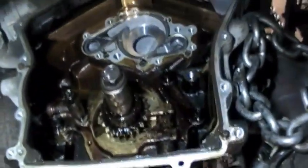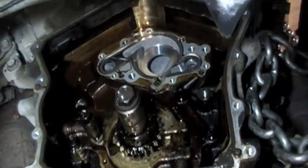The timing chain will actually rub up against the water pump - here's where the sprocket should be, and the timing chain runs down here and goes around. There's a little cover on this part of the water pump, and the timing chain runs past it and scrapes it. If you drive your car long enough, it'll wear right through, and then you'll have coolant pouring into your engine, spin all your bearings, and that's when you get your motor knocking.